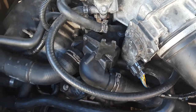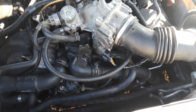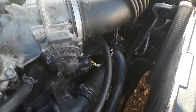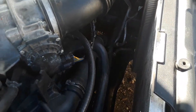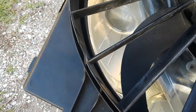This radiator also cools the transmission. I think I might do a conversion to get a separate transmission cooler and connect those two silver ports — you can see one and two right there. I'll probably do a conversion so it doesn't have to run through the radiator, but maybe I'll just stick to the normal setup. Either way, that's why the fan is out — I don't want to put it back in knowing I'm going to have to change it.